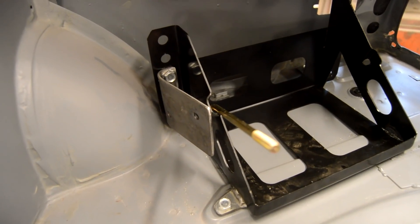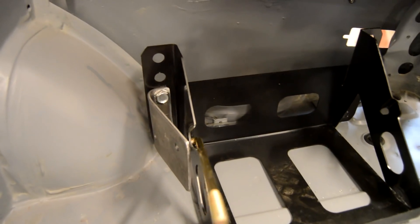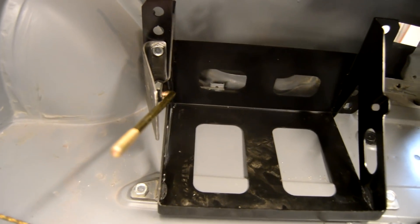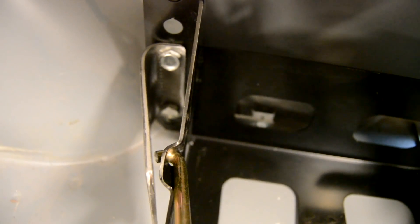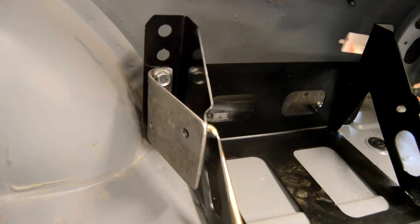Here's that bracket for the breaker — got it kind of angled back towards the battery box to conserve some space, and it looks a little better that way. I also installed the little rod here that actually holds down the battery. It was a bit too long so I cut some of the end off so it fits back in there. Now the breaker will mount to the front of that plate. Next I just need to go ahead and install it, and then I think we'll probably start working on some battery cables.